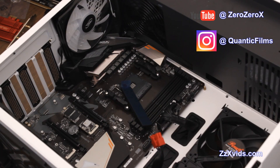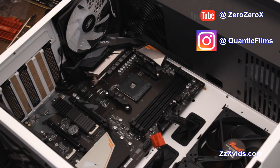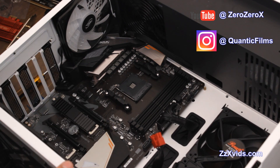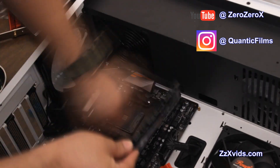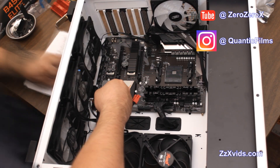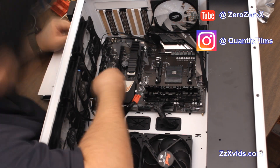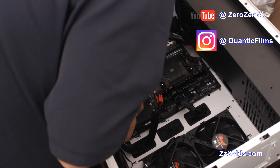Let me show you the spreader — here it has a sticker, we'll take that out. We'll put that on top; it's provided by the motherboard, by Gigabyte. It's going to keep the drive nice and cool. This is not a necessary step for most people — PCIe 3 NVMe SSD drives don't need that much heat dissipation, but PCIe 4 drives do need the spreaders. Now let's install the RAM — these are 16GB of G.Skill RAM, dual channel, so there are two of them. We're going to skip one of the sockets, leave one empty, then one full. We're installing the headers — the audio and LED headers on the computer from the case to the motherboard. This is the USB 3.0 header for the USB 3.0 connections on top of the case.